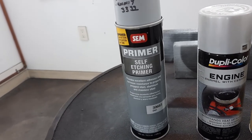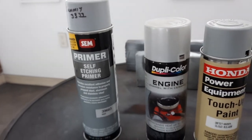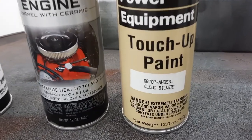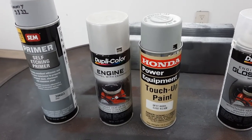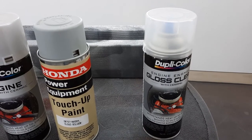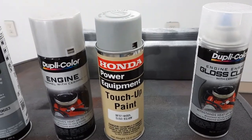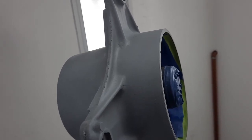The process I've come to is I start out with a self-etching primer even on aluminum - I don't know if it's needed but I do it anyway. Summit's got it for $33 by the way. Then I go back and forth between the Duplicolor silver or the Honda Cloud Silver, which you can get at Tractor Supply. On this one I'm going to use the Honda Cloud Silver, and the clear I use over the Duplicolor engine paint. I prime just enough to cover - I don't like a lot of buildup on the wheels because it just flakes off if it's too thick.